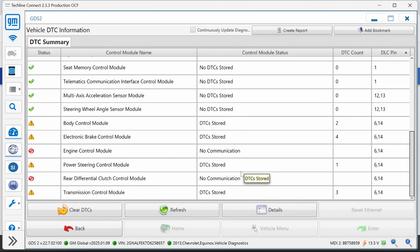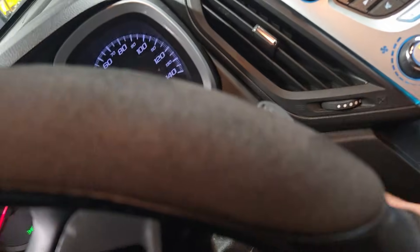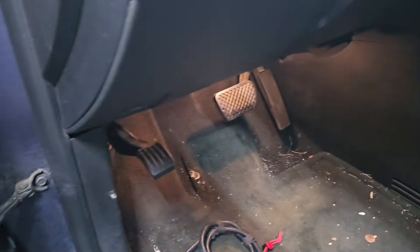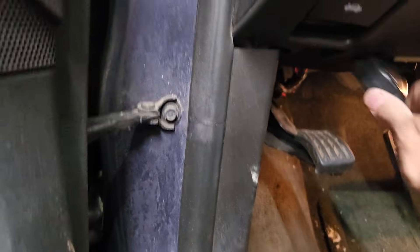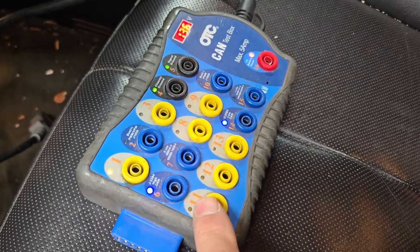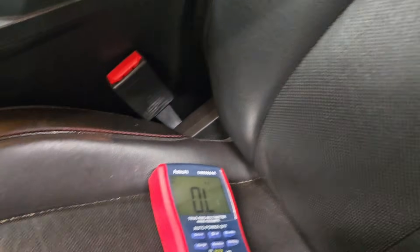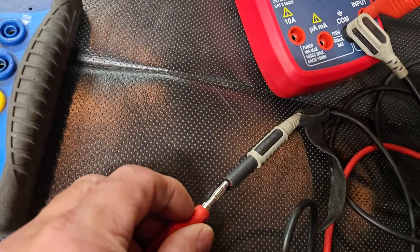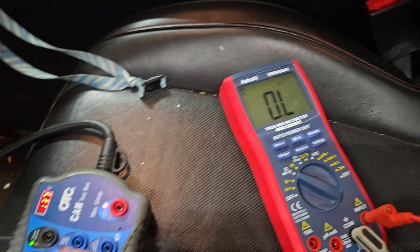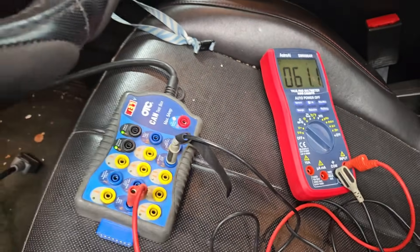The next thing I can do is take a look at the resistance of the CAN bus. I'm going to turn the key off to try to get this network to go to sleep, pull the scan tool from the DLC, and plug in our DLC breakout box — this is an attempt to get a look at the CAN bus resistance. Pins 6 and 14 are still active, so we've got to wait for those to go down. Now that the CAN bus has gone to sleep, I'm going to measure between pins 6 and 14 — I'm expecting 60 ohms. And we have 60 ohms, which means the network is intact up to the PCM and back to whatever modules are on the back of this car. We're in good shape there.